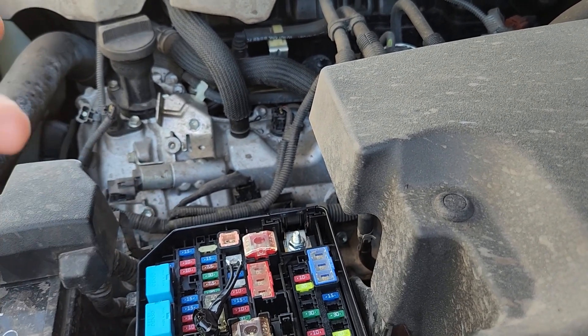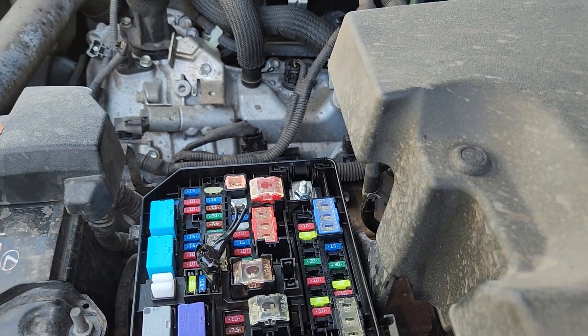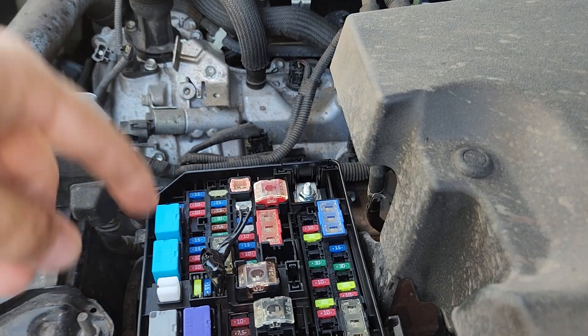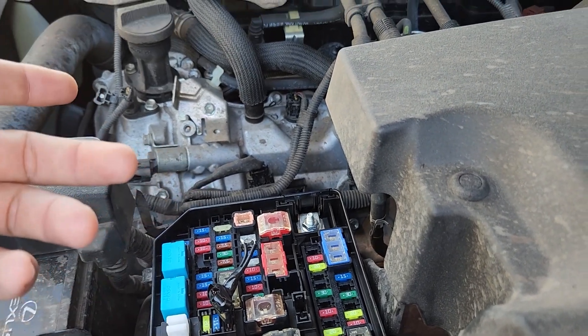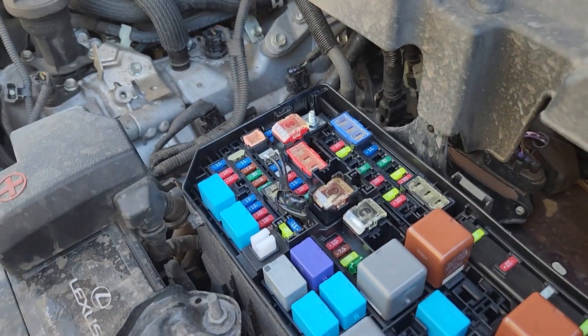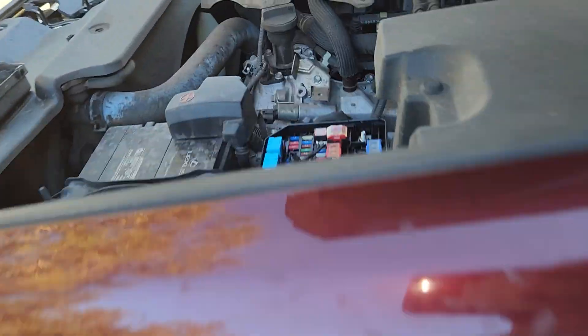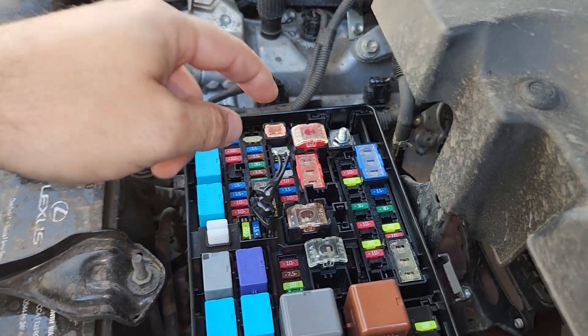You can measure a bunch and pick and choose. There are also different diodes you can use that have less voltage drop, so you can really use this to tune exactly how much voltage your alternator puts out. I did a lot of trial and error to get it to the voltage I wanted to charge my battery as effectively as possible. I'm going to show you how to first make that little contraption to plug in in place of the stock fuse to increase the voltage out of your alternator.